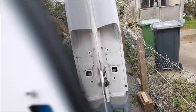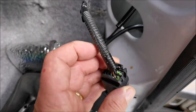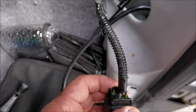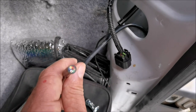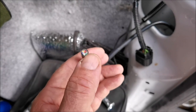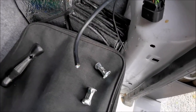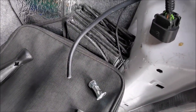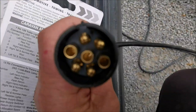So with the cluster off — I've actually took the lighting connection off. The colour coding is not the best; I've even looked in the actual manual. You're going to have to get a Haynes manual. I'm going to have a go at stripping this back — this is the light cluster for the towing hitch. I know a lot of these are pretty straightforward. I use: red is stop and tail, green and yellow are left and right indicators, white is earth, blue is — I've got it all written down, so I'll go through it with you and we're going to test them. I'm going to connect the earth up first, then go through each one, and then we can tap into the cluster. Strip your wires back. How many pins is yours? In this one we're looking at the seven pin — that's what we're going for.